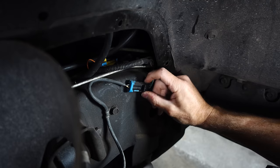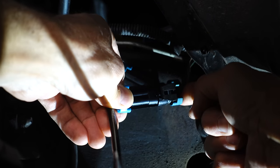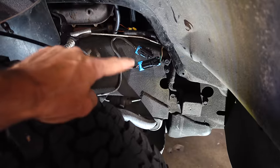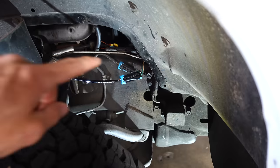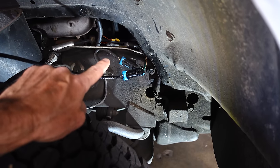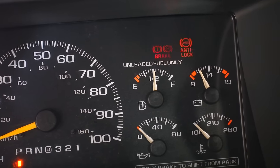Because I have such good access to the plug end of the sensor, I can simply unplug it, take my brand new sensor, and plug this one in. Now I have the new sensor plugged in and just loosely hanging here — not installed whatsoever, just plugged in so we can turn on the key and test if that old sensor was bad. I have a 50-50 shot that it was the passenger side. Turning the key on: the anti-lock light persists, it's still on. So maybe if it is a wheel speed sensor, it's the driver's side. Let's go ahead and do the same thing on that side.